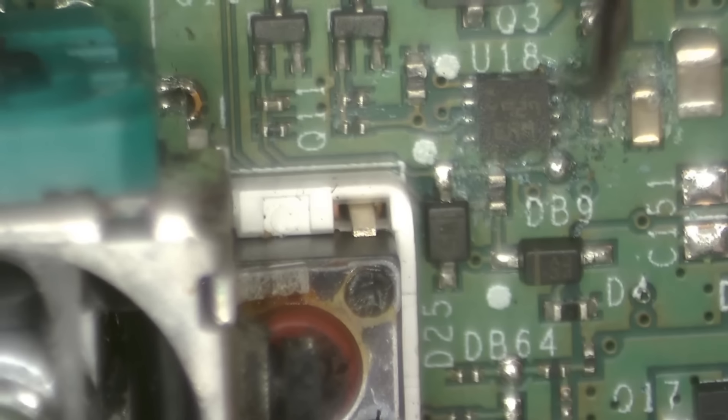I'll make sure the board is fully clean to get off any smoke residue, then it'll be time to reassemble. I'm removing this corrosion with my dental pick, which helps me see the joints better to check how the solder looks. One of the main problems with this type of corrosion is it can separate the chip from the motherboard — the solder joints can go bad. Another problem is it can bridge two joints together, causing electricity to flow between them when it shouldn't. But overall, these solder joints actually look pretty good — once cleaned, they are nice and shiny with no corrosion on the board itself.